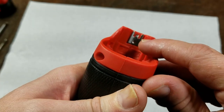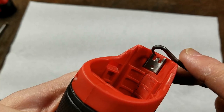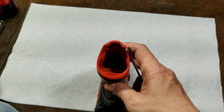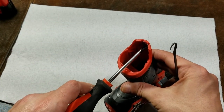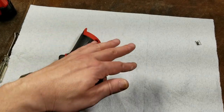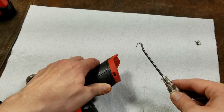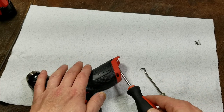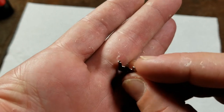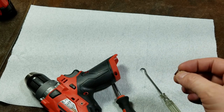There is going to be this metal clip here. It has a little tab that prevents it from sliding off, and you'll want to get in there with a pick and lift up that tab while simultaneously working with a screwdriver to start getting it lifted up until the tab goes past the case. You can just get under the edge of the clip with a hook pick — really the best tool in this situation. Just slip it up with a smaller screwdriver and the little clip will come right off. If you over-bend the tab and it's sticking too flat, go ahead and bend it back down so it'll snap in tightly.